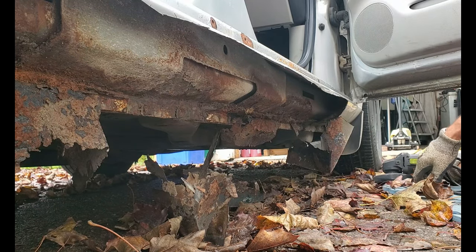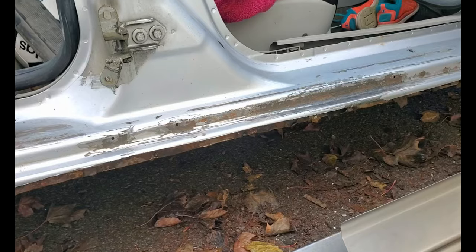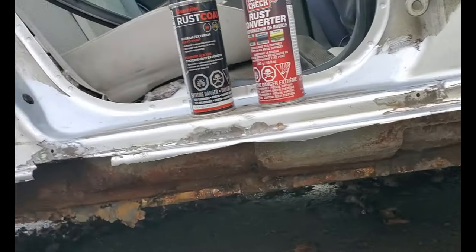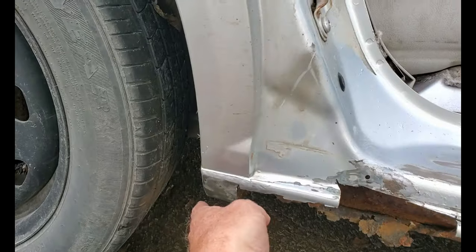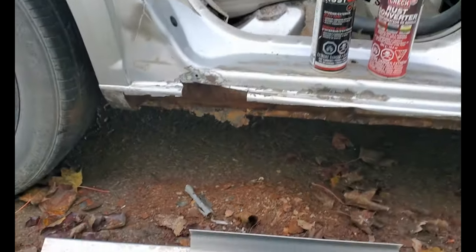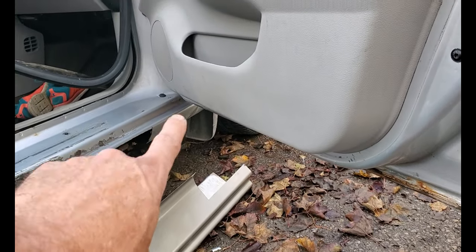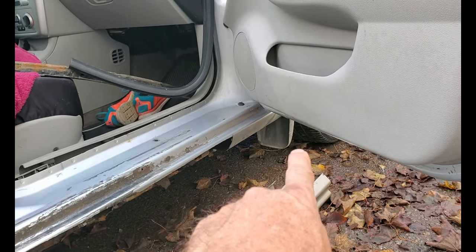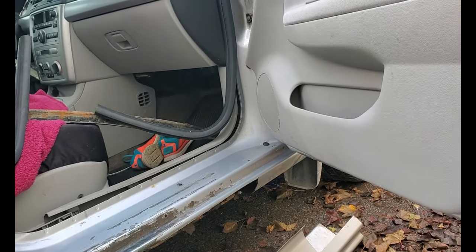We may have actually found some good metal. Got most of the rusty bits now — as you can see, not much left under there, chopped away. There's a little tiny bit of good metal at the back that I'll be able to use to weld the end of this new rocker on. I think I won't need to use the whole piece for the front — it looks like it's not too bad up under there. I should be able to weld into there and have a nice spot to do my body work.